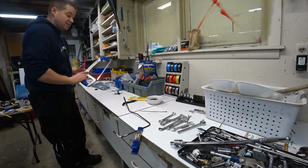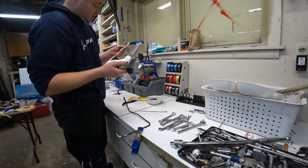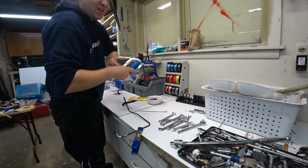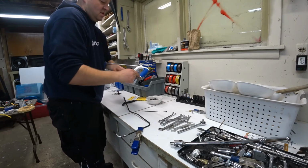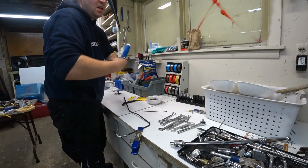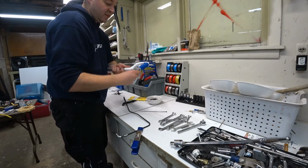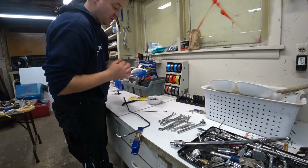Now I need to find this guy. I'm going to go ahead and change out the blade. This is, I think, a 24 tooth blade, but I'd like to put a finer tooth, so I brought some new 32 teeth per inch blades, and those are real fine. That'll give a nice smooth cut. I won't need much filing to make it smooth for the flare.